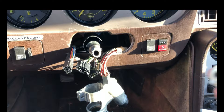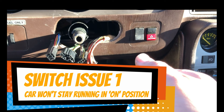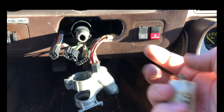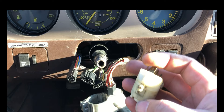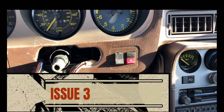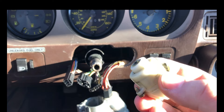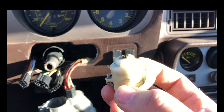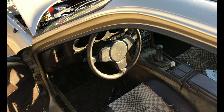I've got the replacement switch in now and everything is working properly with the original key. This is the switch I removed from the car — I've seen quite a few failures with these switches. This car, as you saw, would start up and run just fine so long as it didn't go back into the on position where the car should run. Another issue I had was that the car would start up and run occasionally but sometimes the starter wouldn't even turn over, and replacing the switch fixed that as well. In another car, it would start and run perfectly fine, but whenever you remove the key it would not turn the accessories off and run the battery dead. Replacing the switch in all three of those cases was the fix. They're about ten bucks — there are probably more issues you can get from these things, but those are the three I've seen.